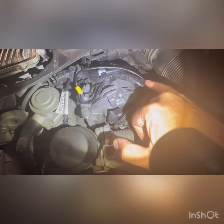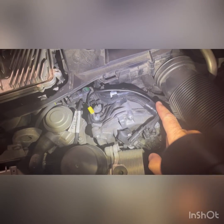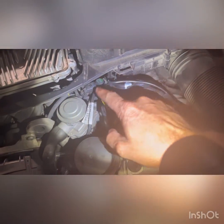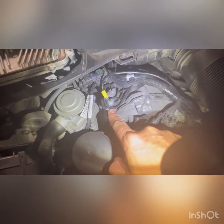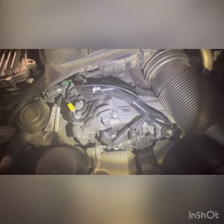What you want to do is splice that open, connect the diode to it, and then the other piece of the diode connects to this wire. Run it all the way and connect it to the engine mount. The reason for this is you basically just have a voltage problem on the compressor. I'll put a link in the description to the diode you want and a short diagram showing exactly how to do it.